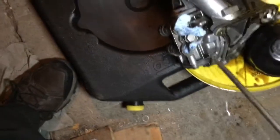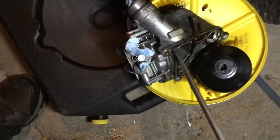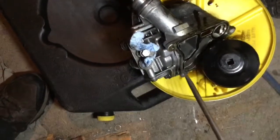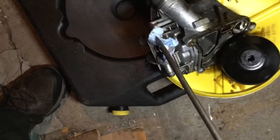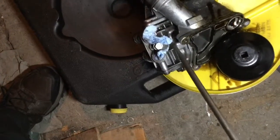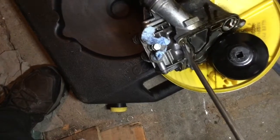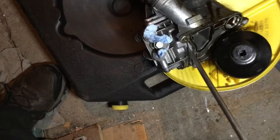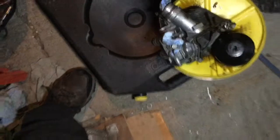But you have here, this is looking from underneath. This is the flange that goes on the side of the cylinder head. These are the two hoses that go to the oil cooler. So the flange here, there's a seal also, and there is a dead end of coolant that connects with it. It's really just like a cap to seal it. It's not connecting to anything, but if this seal is bad, it also can bypass from one to another, oil and coolant.